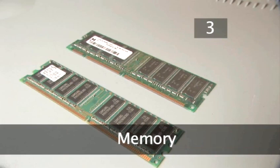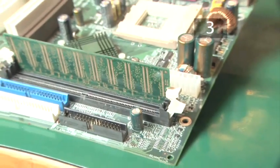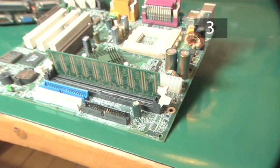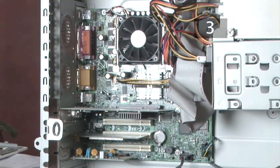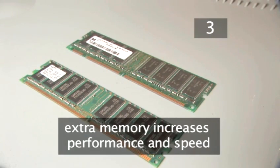Step 3. Memory. The memory in your computer is where the data you're currently using is stored. It's moved from your hard drive into the chips on the memory so the computer can use it quickly. It's similar to a filing cabinet and a desk — the data you want to keep is in the filing cabinet, but when you come to use it you move it onto the desk. Each computer requires a specific type of module. To determine which one you need, you can look in your computer's user manual, the manufacturer's website, or simply note down the make and model of your computer and seek advice from a local computer shop. The reason you would want to replace or increase the amount of memory in your computer is to improve its performance or speed.